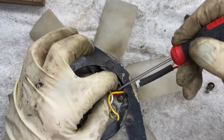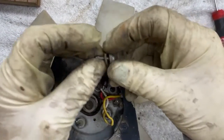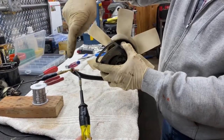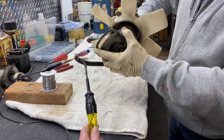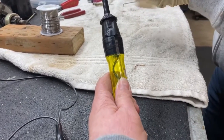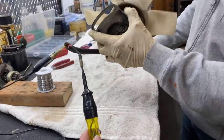One thing I want to point out — make sure that you get this shoulder right. This is an insulator, so that insulator is going to go over this and then this on top. I've got a simple 12-volt test light hooked across the two wires. We give this a spin and it lets us know that this is working. The bearings sound good in this too, so not terrible. We're ready to put this back on.